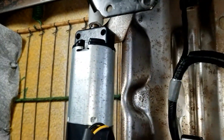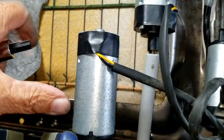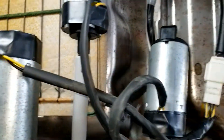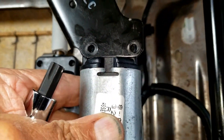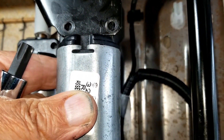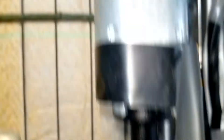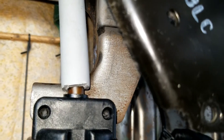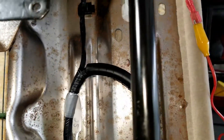These two are to raise it up — this one raises it up and this one adjusts the back forward and backward. So you have three motors underneath. There are only two bolts that hold this motor — the one that slides the seat forward and back — in place. And there are two rods, one goes in each end. You can see on this one in the background how they go on there. That's the one that raises and lowers the seat, and it turns both of them at the same time to make whatever it needs to happen.